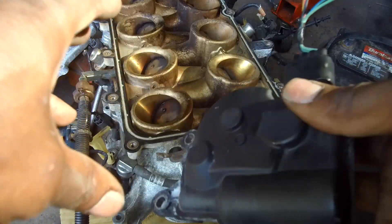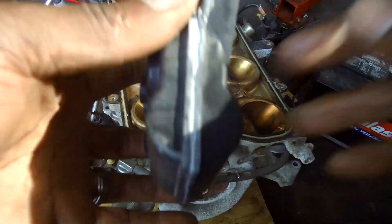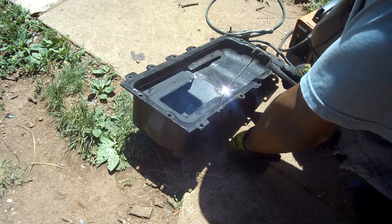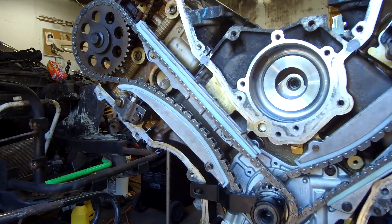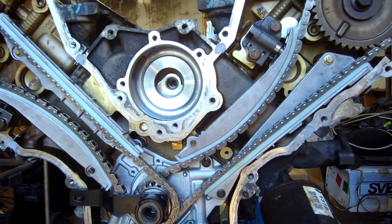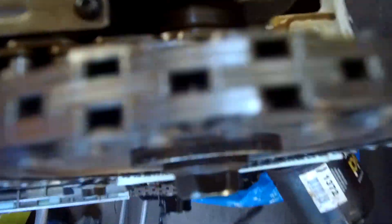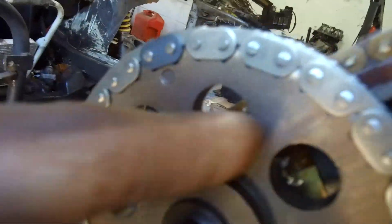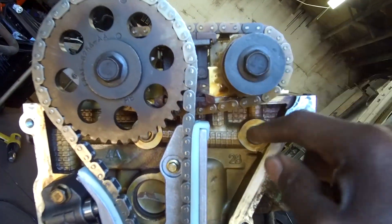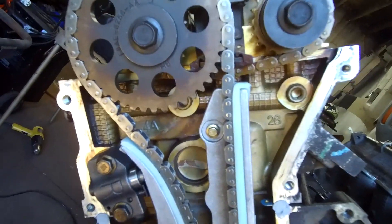That's my idea on how I'm going to probably do that. I don't have the pieces with me. So as I was doing this, I started and welded up the oil pan. When I started doing the bottom of the engine, trying to get everything right as far as the pickup tube height and all of that, then I just kept on going and I started doing the timing. You can kind of see the timing marks right there — there's another one behind there also, another timing mark underneath, another one up here. There are keyways on these cams that need to be face down. When you have your chain and your sprocket together, you put it on in one piece and do what you have to do.